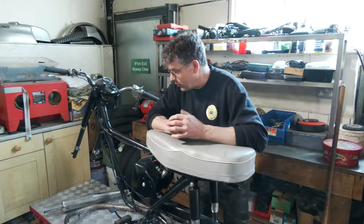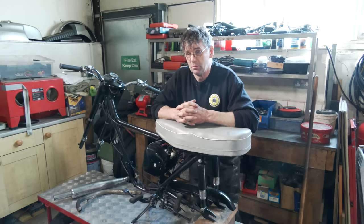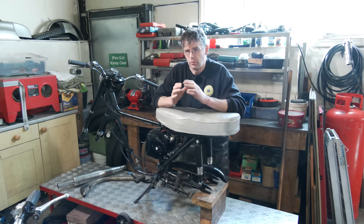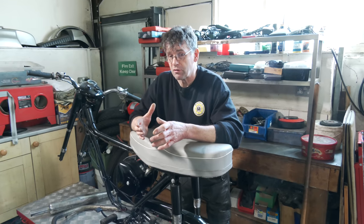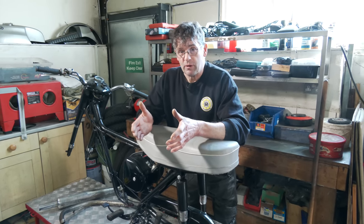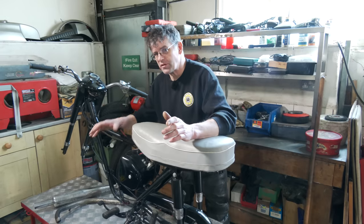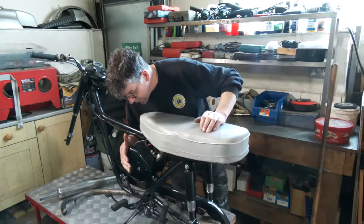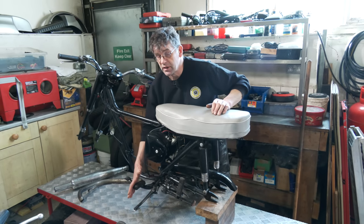You've probably seen this in the back of the workshop — it's been here for about a year. Customer's Tiger Cub, little 200. He wanted it recommissioned. The wheels were completely shot — the chrome had gone badly, and when the tires were removed, the back of the rims were so badly corroded with rust they weren't serviceable. I said you might as well have your wheels rebuilt — new spokes, new rims, new tapes, tubes and tires. I've done all the frame for him, cleaned it back, re-bushed it, done all the little bits needed. The loom's been put back in, bushes made where worn. He's had his tank, mudguards, and stays sent away and painted.